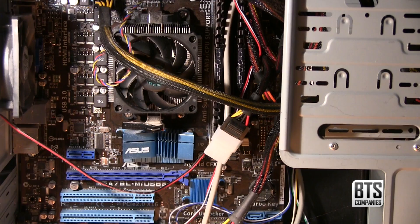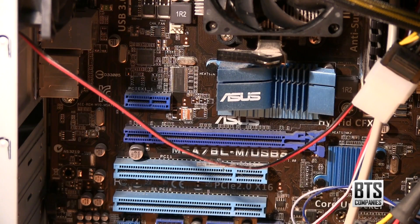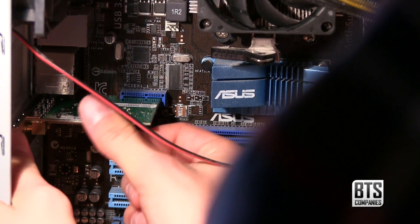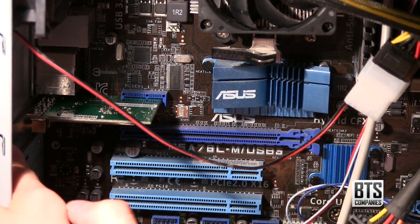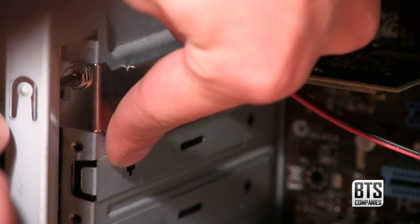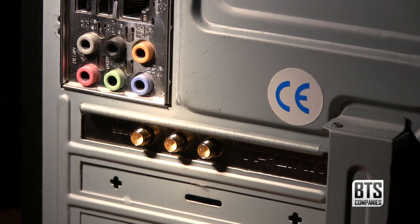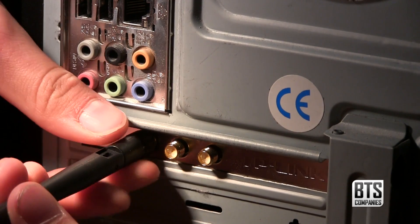It's really easy to install. Take off the side of your computer, make sure you have a free PCIe slot and remove the relevant section of the back of your case. Next push the pins gently into the slot and the card should fit in like so. Secure it with a screw and it should stay firmly in place. Now we can attach the aerials to the back of the card and the hardware installation is complete.